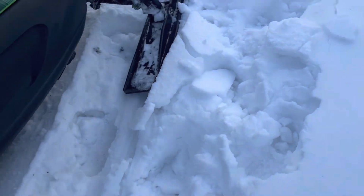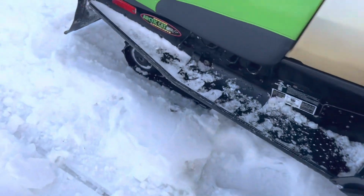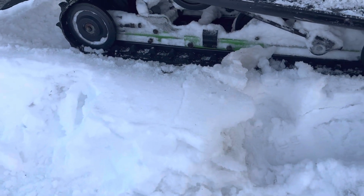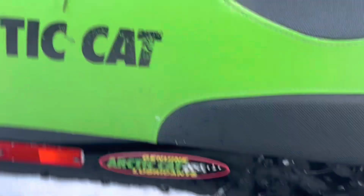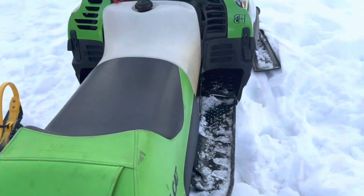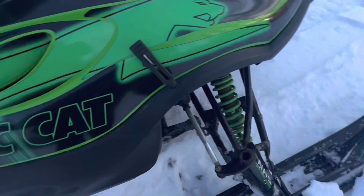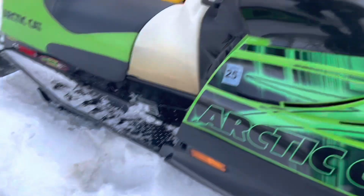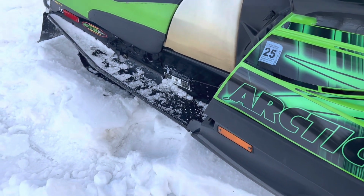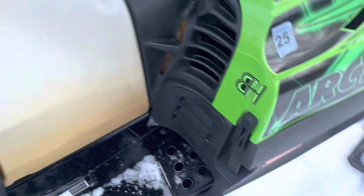The main reason we had to do the skid is because there's these 2 bogey wheel bearings that were pretty dang rusted up, and so we had to change those because the track would barely spin. And when we're towing it, you guys probably heard it squeaking. That was a bad representation. That's not how you say the word of the noise it was making, but yeah, it was squealing pretty bad. We think it was those bearings, because it runs and drives now. You guys just heard it run.